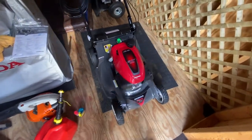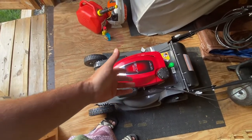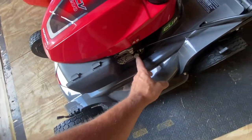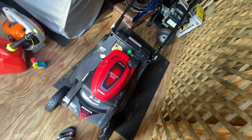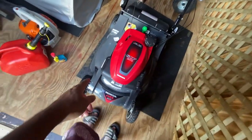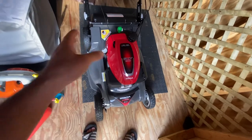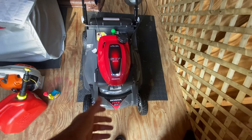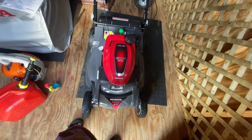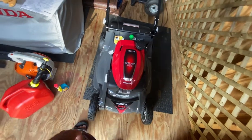One issue a lot of people have is when they tip the mower over to change the blades or clean it. You want the fuel shutoff off, and you want to tip it to the right — always to the right, so the air filter stays up. If you tip it to the opposite side, all the fuel will go into the air filter and it won't run right. I've had that happen before and had to remove the air filter, start it without it, and buy a new one — so that's a pain.